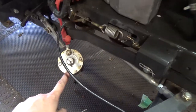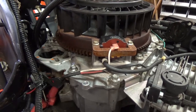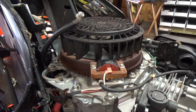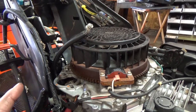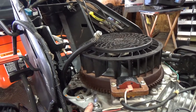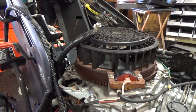The starter, the gear popped up again, and then it stuck onto the flywheel. It turned over the first time, and I even took the spark plug out because my Eliminator battery doesn't have enough cranking amps to actually turn this thing when the spark plug's in. Going back to what I said earlier about this needing the $100 battery, not the $60 one, because this one needs 300 cold cranking amps, that's CCA. So that's a big difference, guys.